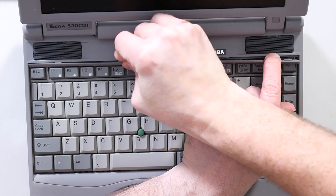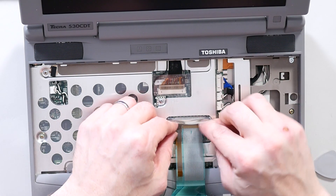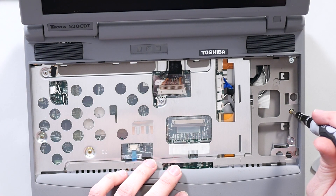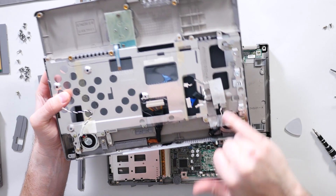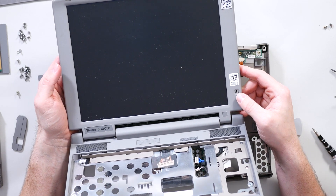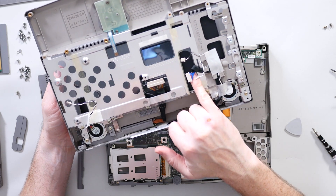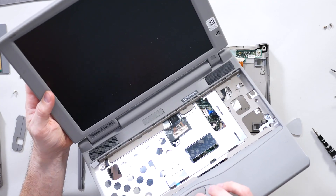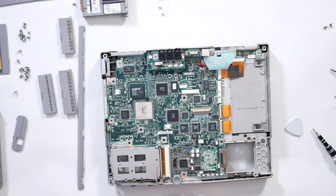Putting screws and fixings under the keyboard. I'm glad I didn't just prise this thing apart. This little blue header down here I can't really place — it comes up and goes back through the loom of the screen. It could well be the microphone. Definitely wasn't going to be a webcam in this generation of laptop. Otherwise we've got screen, speakers, and maybe that's the microphone. Actually that's probably power for the backlight because that's going to be data only. And of course you've got the trackpad buttons — not a USB connection like they would be on newer laptops, but probably discrete buttons going back to an onboard controller.